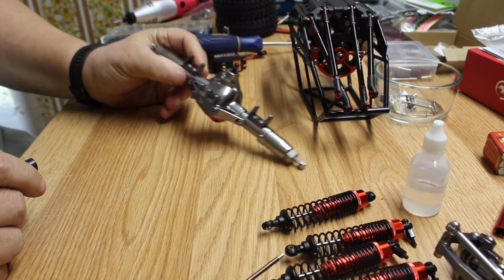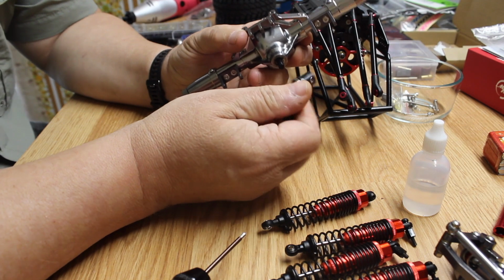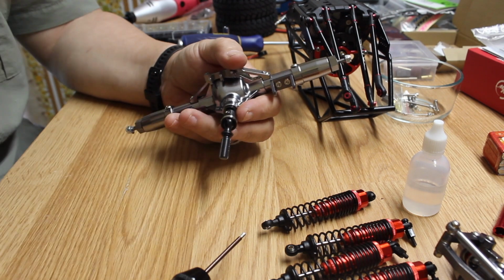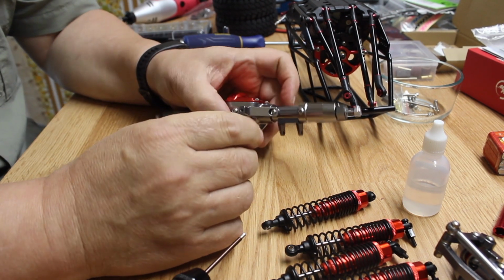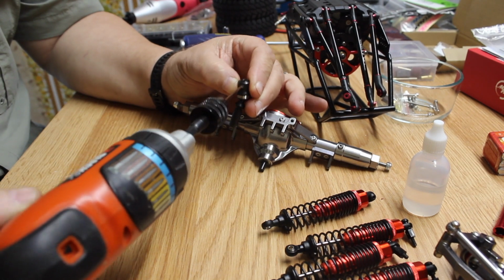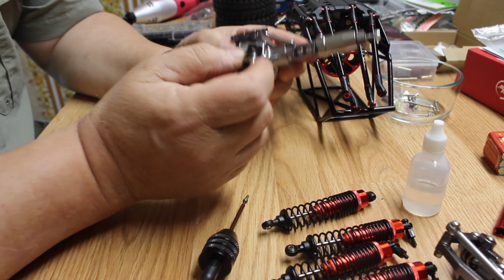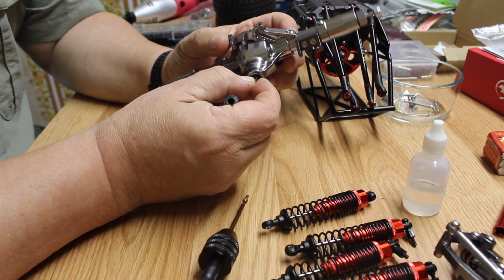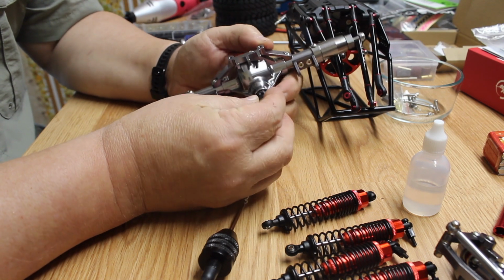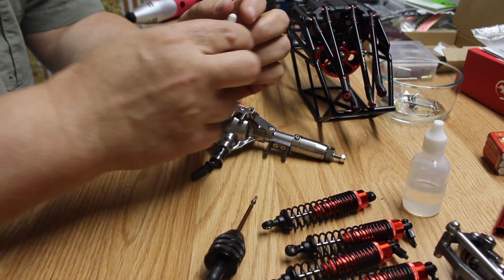Alright, here's the rear axle. We're going to first put on these U-joints for the drive shaft. It'll make it easier while it's out of the vehicle. Now these little U-joints have a little pin inside them that's screwed in, and there's a hole in the drive shaft connection here on the axle. So you place this U-joint here, and then we've got metal on metal here.